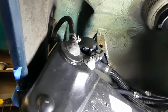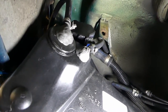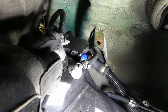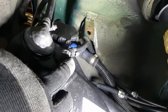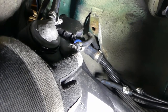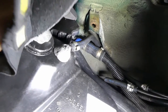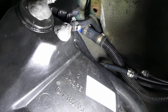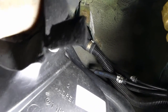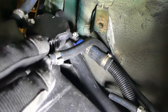One other thing while I was installing the tank: I used a worm drive clamp on the 8x13 because that's what I had available, then ordered a bunch of one-time-use clamps suitable for the 6x11 and installed those. I found that putting the pressure sensor onto the new unit required channel locks to squeeze it together — there was a gap there.